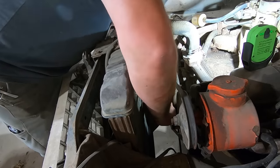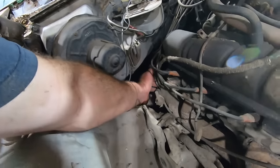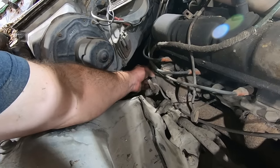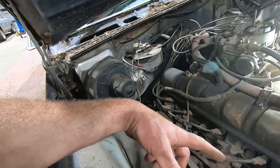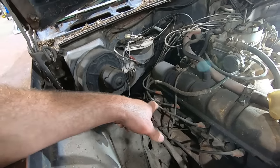She's loose. Ish. Seeing how this engine is hard to replace, early, expensive, with our past history, we're gonna pull the spark plugs out and spray some lube down there and then crank it over. And then we'll be able to look at the spark plugs and see how they look, if there's been moisture, if it's been burning oil, if they're new, I don't know. And the other thing is we gotta take the plug wires off anyway, because whoever routed them laid them right on the exhaust manifold. They're not really melted through, so that tells me whoever put these plug wires on didn't run it for very long after that. So it'd be a good opportunity to do that. That and they're just so gosh dang easy to get at over here.